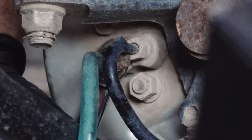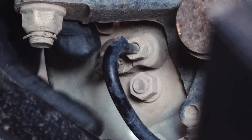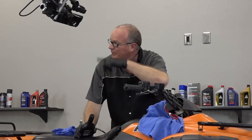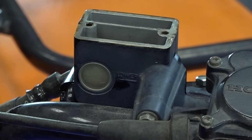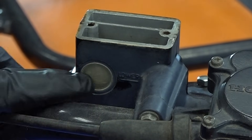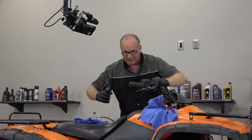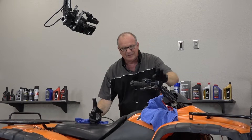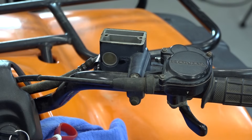Alright, and that should do it. Just make sure you go back and put your dust cap back on because we don't want a bunch of dirt and mud and whatnot getting shoved in there. Now that we've got the system bled through, let's go ahead and set our level. There's a little line right here that says lower — it's actually in the middle of the sight glass. Knowing that we have new brake pads on the front, I can go above the lower mark. Because if you take it up too far with old brake pads, when you go to replace them you compress those cylinders up front to get your shoes to actually fit and that forces the fluid back up into the system and overfills the reservoir. So let's get this thing filled up a little bit above the lower mark.